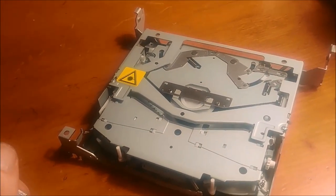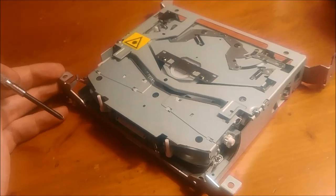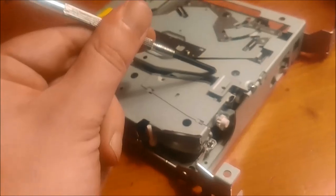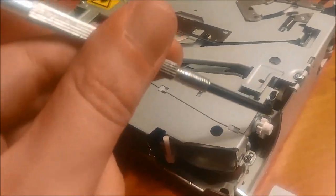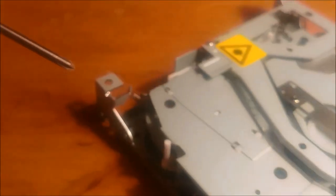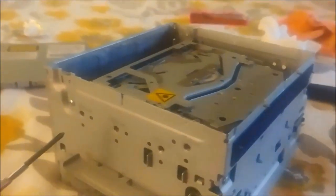I've got this thing back together now. I didn't do any video of the disassembly, but there are two pieces I already took the screws out of. This topmost piece comes out first — it's only held with two screws, one on each side. Then this next piece is held on with two screws as well, plus a spring that you just unhook from its post. Same thing on the other side — you can see the spring and then the screw. Getting the CD mechanism out of the head unit itself is fairly simple.